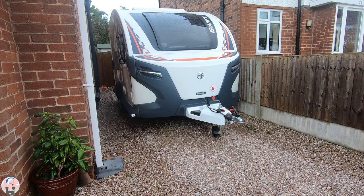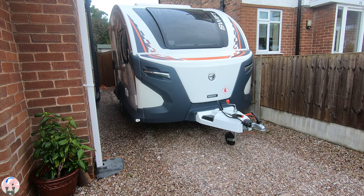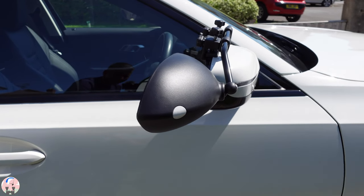So let me explain. You've bought your Basecamp and it's the first time you're going out in it — let's talk about what's involved at a broad level. Firstly, you're going to pack your caravan as you would with a camper van or motorhome, but with your caravan you also need to hitch it to your car. In my case I need to pull it up the drive first using the motor mover, position it behind the car, hitch it up, connect the electrics, and put the towing mirrors on.